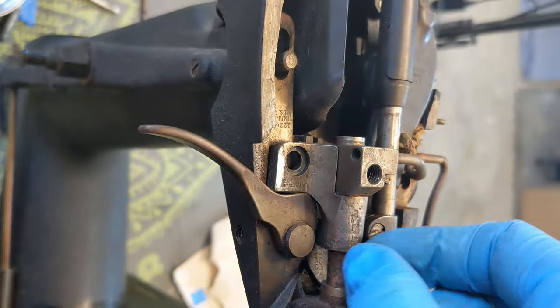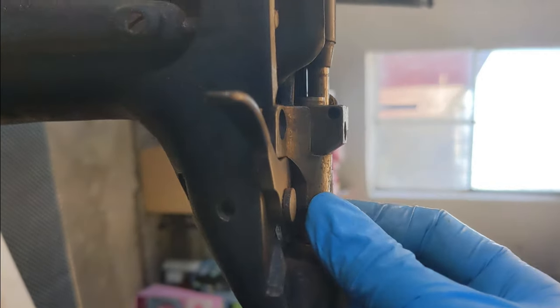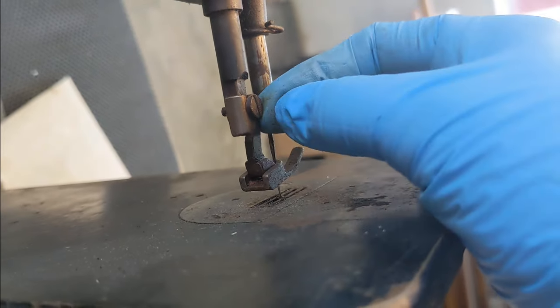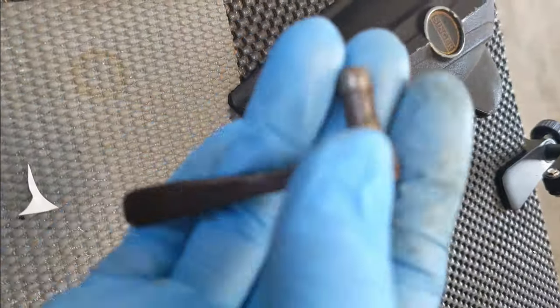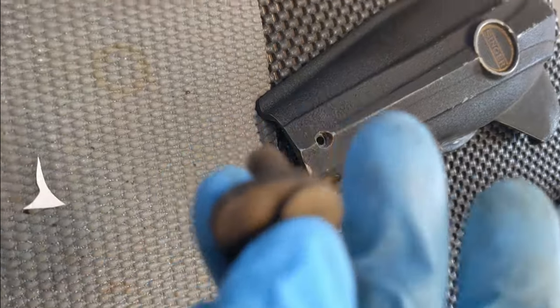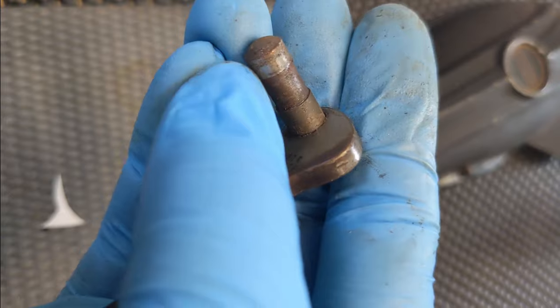Let me see — there's a little hole right here. I can't see if there's a screw in there or not. Let me do some poking and see if there's a way I can pull this off of this shaft. If not, I'll remove this needle because that's scary, take off the little screw here and the presser foot, and see if I can just push that entire shaft up. I was able to just pull this lifter lever up — it's kind of nasty, but that's what it looks like. It just pushes straight down into that hole that's in the casting, and then the set screw tightens down here.